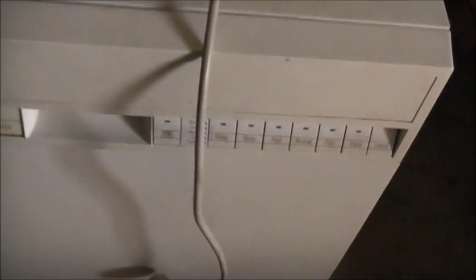Those Gloria brand capacitors are always used on these dishwashers. If you see something like that in one of these dishwashers and you get the symptoms — it doesn't work — check this capacitor and replace it first. And who knows, it may work. But the membrane switch is also a common fault. I'll always start with this from now on, and if it works, that's all it was. But if it still doesn't work, then go to the membrane. But if you press this button and it beeps, and that's it, it means your board's fixed but your membrane's gone.